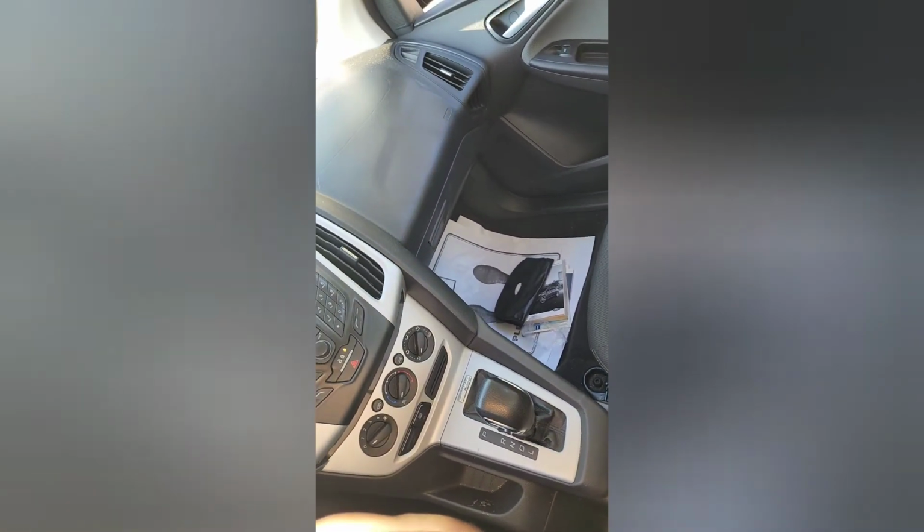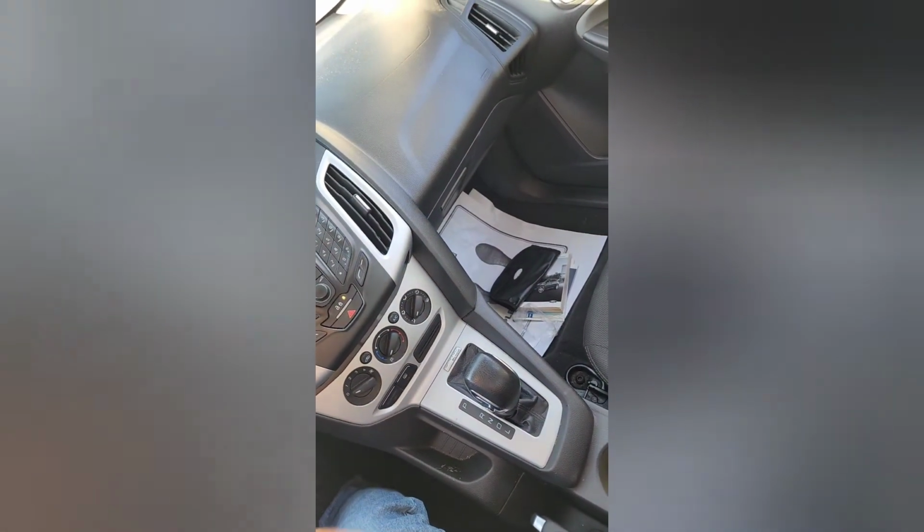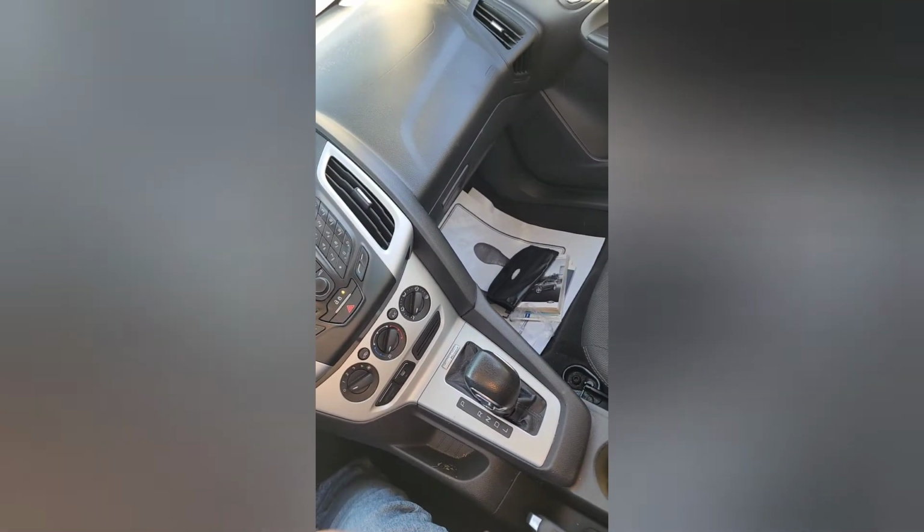Another thing, since this is an adapted learning transmission, if you floor it about 3 times and get it wide open throttle, that will reset the learning on it. So like if it goes by your driving behavior. So if you want to reset it, find a safe spot, do it from straight stop, full open throttle. And this is also, if you're using a scan tool, it does the same thing. It has you open the throttle. Only if you ain't got a scan tool, you can do it this way. And that will reset the TCM adaptive learning.